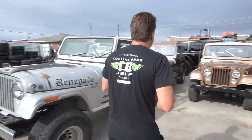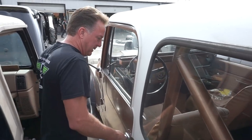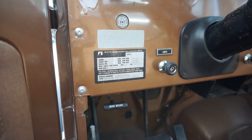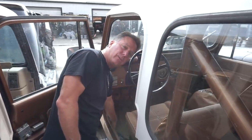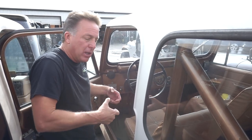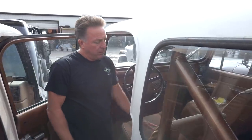From 1976 to 1979, the VIN tag was on the dash - and this Jeep right here is a beautiful example, they were right here. Then in 1980 they changed the style of decal and went inside the driver's quarter panel - that was used from 1980 to 1981. In 1982 they went to the long decal, which we have in production, and that ran through 1986.